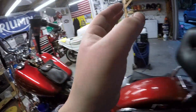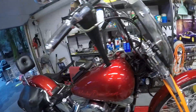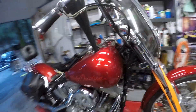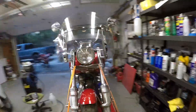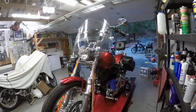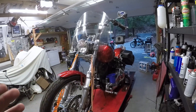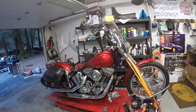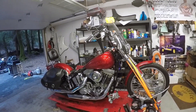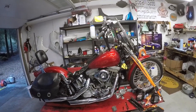You can see the nice burn I got from the exhaust — that was awesome. Anyways, put my hand over it, air hose, pressurize the tank, and it pushes it through. That way we'll clean out the line and all that good stuff without taking the tank off, because I have to charge for my time. If I take this tank off and clean it, it's going to take hours. Also, if I take the tank off, I'm just going to have to end up relining it, so we're not going to do that. Fortunately, there's not a lot of rust in the tank — looking inside with a flashlight, I don't see a ton. Hopefully the vinegar will clean up what little rust is in there, and it's coming out clear now, which tells me the tank's pretty clean.